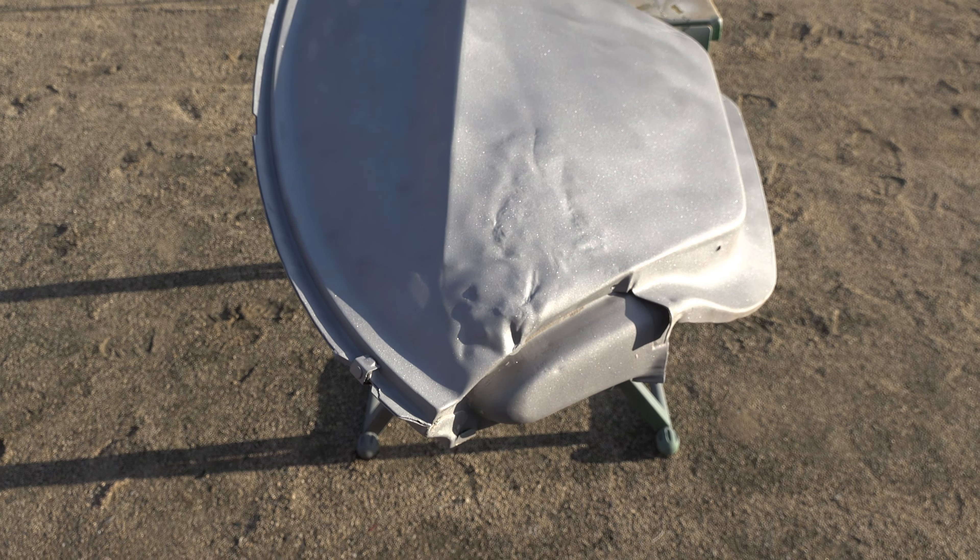Next up are the spring clips. These clips are installed in the trim piece first. However, this installation can be a little difficult — I had to press down on the trim and the clip against the workbench, and after some effort, I was able to seat these clips into the trim. The diagram showed some sealant going between the stud and the fender, and I had the perfect sealant — tacky tape. Tacky tape is a thick, rubberized tape typically used for sealing windows, but its strength and flexibility make it ideal for other sealing applications. I cut off a small piece of tacky tape and then punch a hole in it with a scribe. I then press the tacky tape onto the retaining clip stud, making sure to press it down all the way to the base.